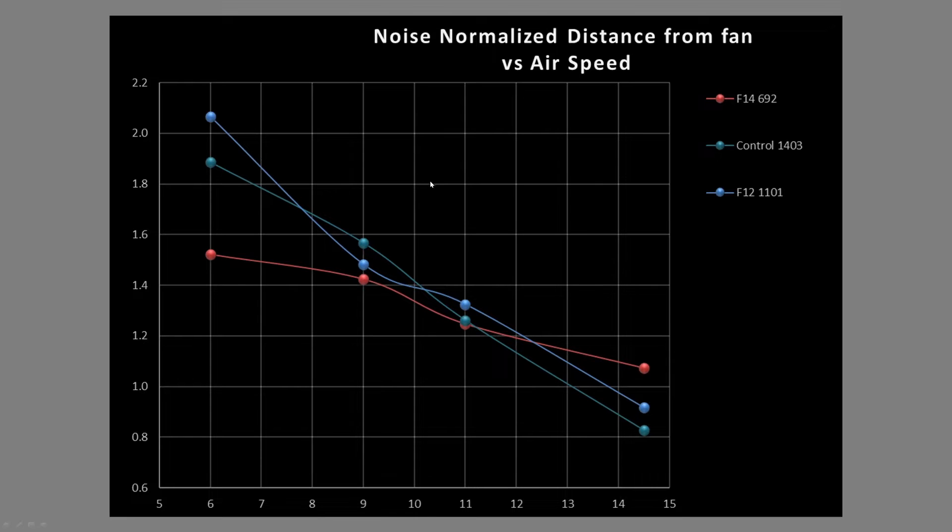The control fan is a composite of three parts Noctua A12x15 to one part A14, blending them to get a composite 130mm class fan to get the best of both worlds. Fans that perform in the upper right direction on the graph are better — essentially A+ tier. Fans underneath the line that are close could still be considered okay, but the farther they deviate, the worse the fan. Air speed is almost always on the vertical axis and the horizontal axis is typically decibels or length in inches — representing distance from the front of the case.